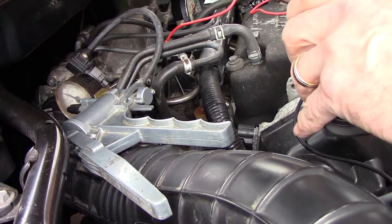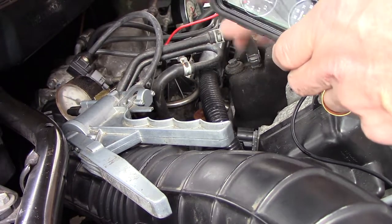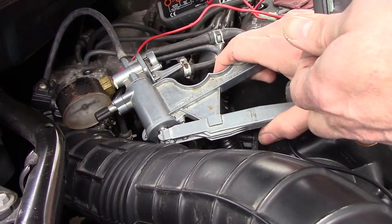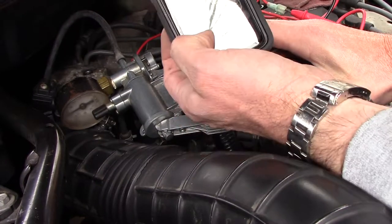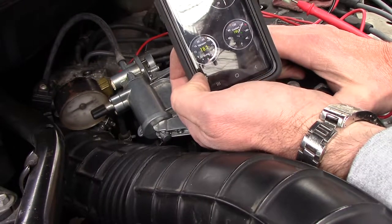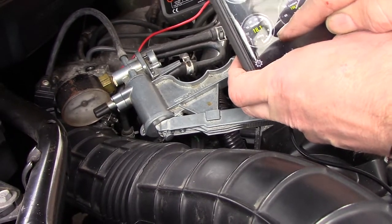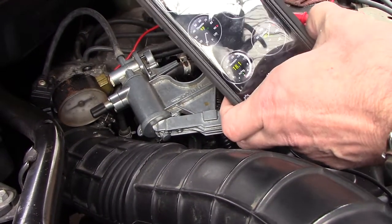So when I had the car running, this value never changed, but I'm beginning to suspect there's a timing issue or a vacuum leak, massive leak somewhere. There's my 2.86 volts. I can apply vacuum to it, and it drops down on the meter. And on the app here, I'm looking at real-time information, the key's still on. If you look at vacuum right here, it's going down, so there should be. So obviously that vacuum signal there is getting to the ECU, but when I was running, it was like 0.04, it was real low.